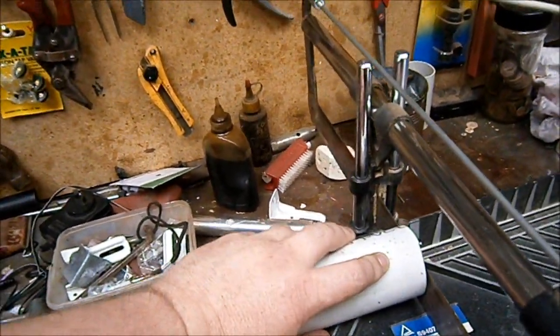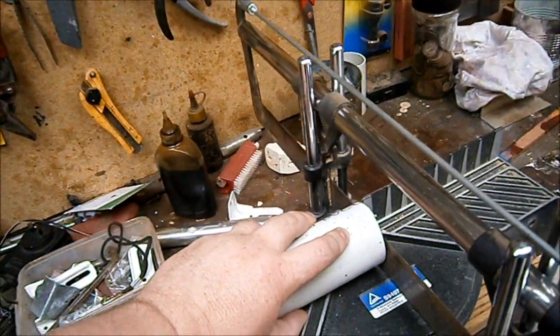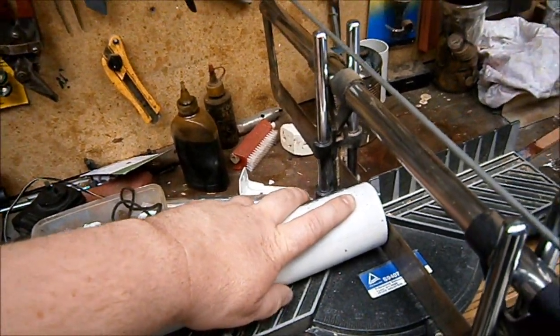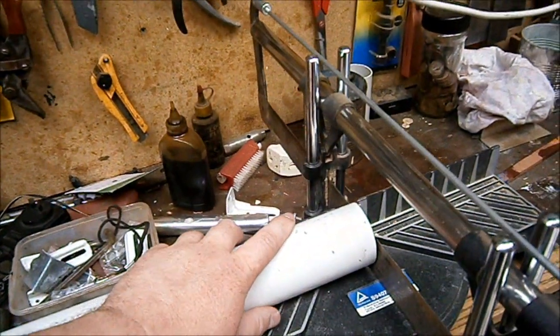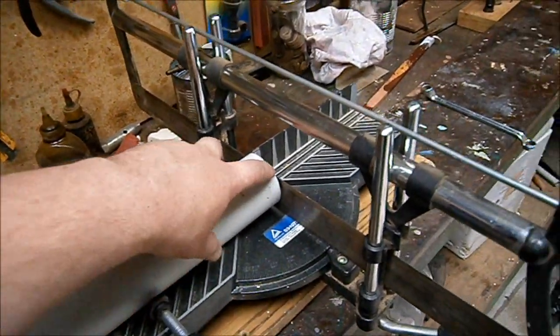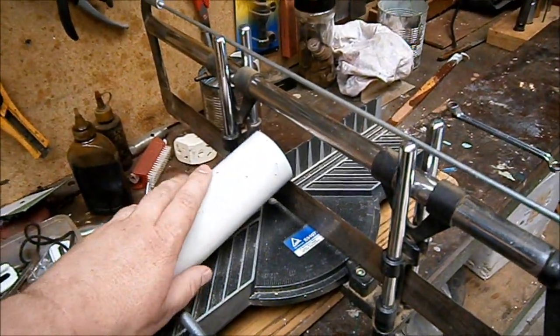That's basically how I do it. The 2 mil extra gives the rims a little bit more protection against bashing into gutters. If you cut it exactly the same width as the rim, then when you slide into a gutter your rims take the full force of it, and that's not what we want. So measure it, cut it, and then I'll show you what to do in the next step.